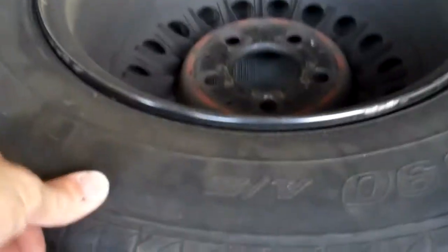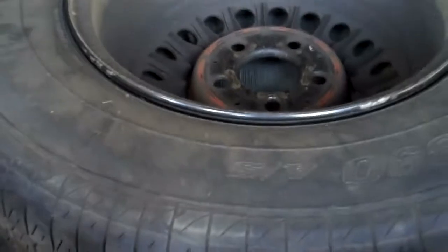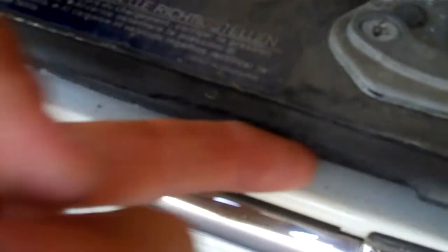The spare tire is flat — it actually has no air in it, so it's going to need five tires. Looking through the trunk, everything seems to be rust-free. I would recommend, though, that you replace the trunk weatherstrip because it is deteriorating and starting to fall apart. The fact that the trunk has really not that much rust will be short-lived if the trunk seal isn't replaced, so I'd recommend changing it.